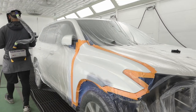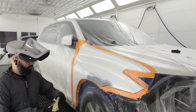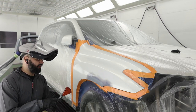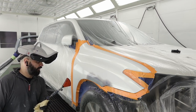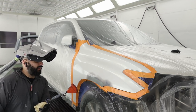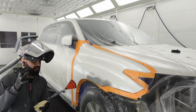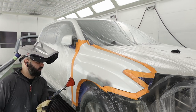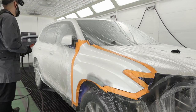I'm going to just start to dehydrate this area. It's got that coat of blender over there, so I don't need to fully dehydrate this — I just need to get it to start, and then I can go ahead and start my blend. You could go over this wet on wet, but I'm going to do my color wet on wet, so I want this to be dry so I don't have to worry about any kind of sagging. All right — that's pretty much dried on the primer. So grab my color.